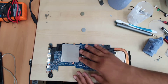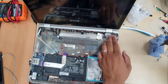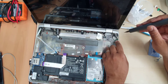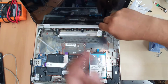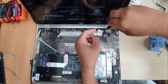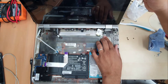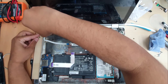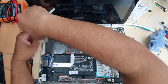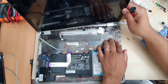Now we're going to remove the top screen panel from the actual bottom plastic cover. The top panel is secured with three screws on each hinge — six screws total. Three on the right-hand side and three on the left-hand side. Once removed, pull the panel towards you and the actual top panel would come out. Still be gentle and make sure you know what you're doing. Don't forget to remove those screws — as you can see, this one is coming up. You just need to play with it a little bit. The top panel is fine; we don't have to do anything from the top.